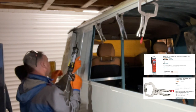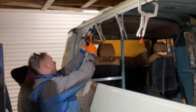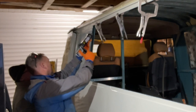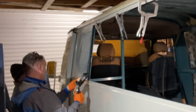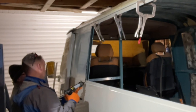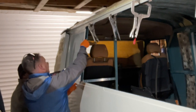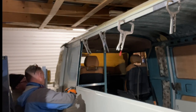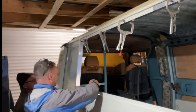Obviously the shape of the van here - we've got to build it slightly and we're going to fit three different strips of aluminium down here to make all that level down that side. We'll just keep building this up and then rivet the whole lot through the side of the van. It'll be as strong as it can possibly be. We'll put this piece of metal in to fill that little recess, get that in place, and then do the same thing again with another layer down there - build it up with the second trim.